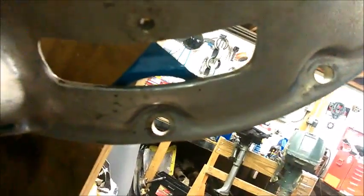While this is taking loose, I did go ahead and clean the heat exchanger, whatever you want to call it. I pulled the mounts off of here. The flywheel's over here, done. I'm doing a little painting. Now let that screw dry. That screw goes to this cover, which goes right here. And if you notice, I painted the pointer, because that's where we check the timing. I painted the pointer blue. So we're going to have a blue nut, black cover, blue pointer, black flywheel.